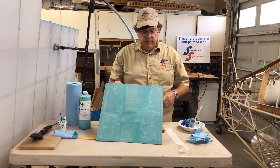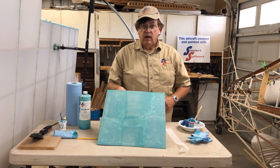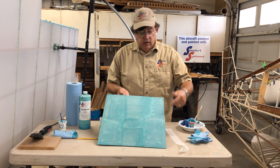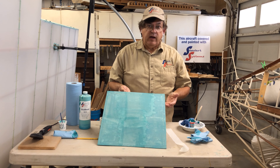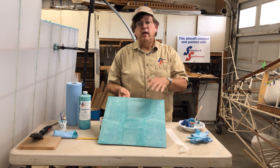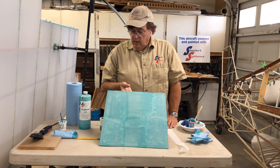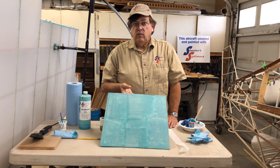That's putting fabric on top of a plywood panel. The only additional step really different from covering a control surface is you're putting glue on the surface when you're done. Otherwise you're putting glue around the perimeter just like a control surface, putting your fabric down, doing initial bonding to the edges, sealing, re-gluing to lock it in, letting it sit, shrinking, and then applying the glue to bond the surface. From this point you're ready to apply EcoFill just like you would on any fabric panel. That's it for applying fabric to wood — I hope that answers a lot of your questions. If not, give us a call and we can walk you through it.